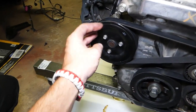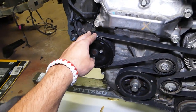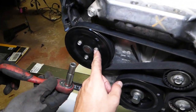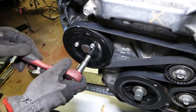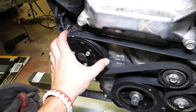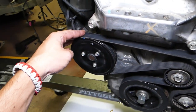When that pump fails, you can develop a leak, it can get noisy and wobbly, and it can even destroy your belt if it develops too much play. Before you remove the belt, there are three bolts here that you need to get loose first — just a little bit. Otherwise, once the belt is off, nothing will be holding the pump and it will spin freely, making it impossible to loosen those bolts.